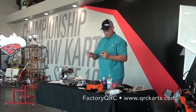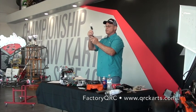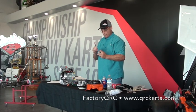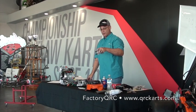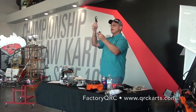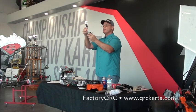I'm going to take and bend this tab down just a smidgen. Now I went too far, but you can see I'm just barely moving it. So I'm going to bend that just a tad — raising it and gently setting it down, rolling it over. I got lucky and hit it pretty close on the money. I set it at 895. Now I know that's my float height.